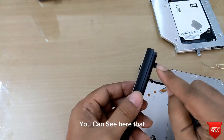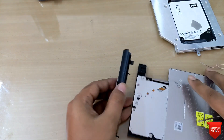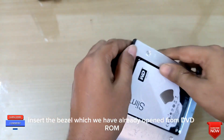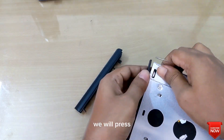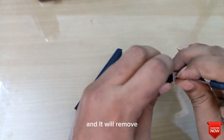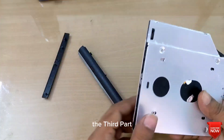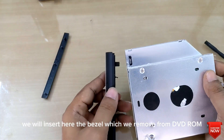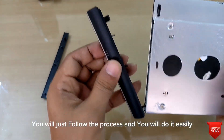The lock is open — we will pull the bezel off like this. You can see here that this is a latch as well as the main latch; if you open this, the rest will open just like this. Now the second part: we will open the bezel from the caddy and insert the bezel which we already removed from the DVD-ROM. Here you see another latch — we will press here, you see the small hole, press here and it will remove. The third part: we will insert the bezel from the DVD-ROM into the caddy like this — just follow the process and you will do it easily.